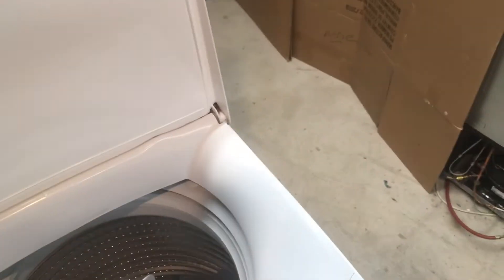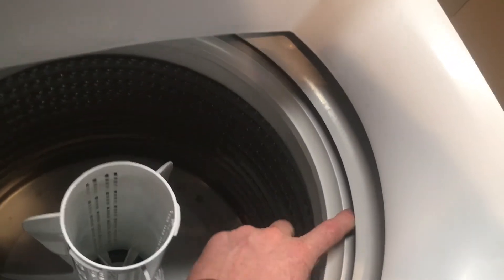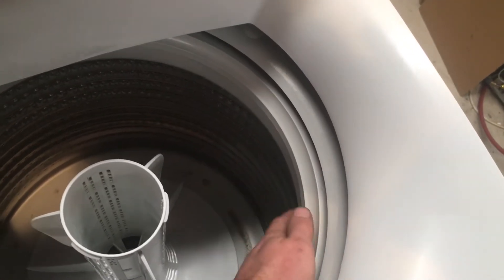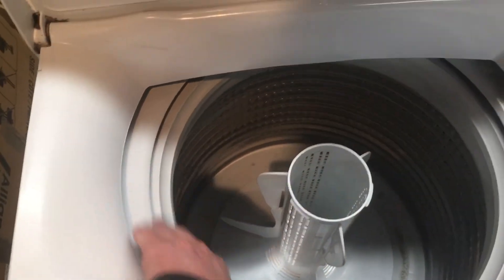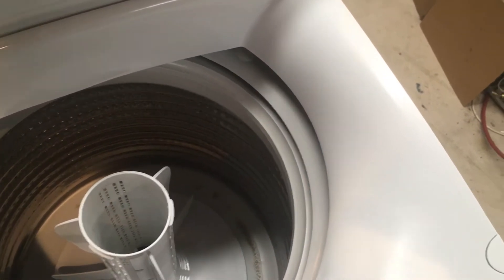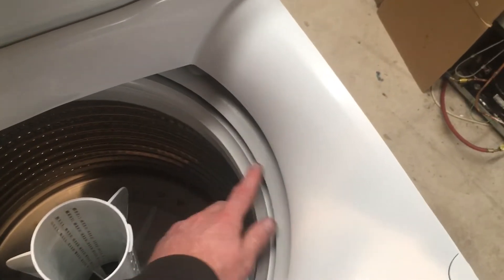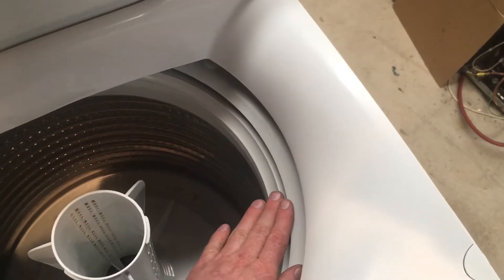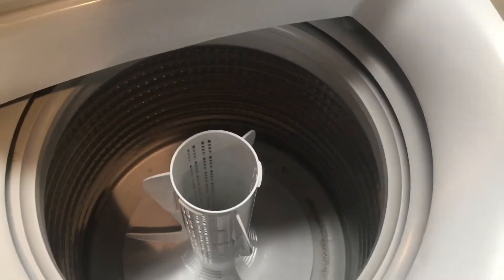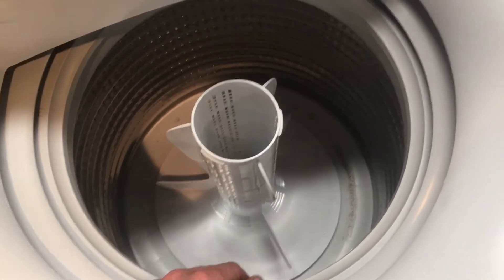For the physical condition of the machine, looking inside the bowl here — looking for the spline drive, which we'll look at further in a second — but looking for any wear along the top of the neck ring from the neck ring wearing onto the water balance ring. As you can see, this neck ring is clean and in virtually new condition. On smaller machines like the 5, 5.5, or 6.5 kg models that are loaded heavily, you actually see what looks like burn marks and melted plastic around the ring. This one has no marks, indicating the spline drive is probably pretty good.